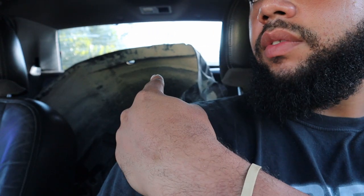because I searched it before we started this. We actually had to cut the full exhaust out and basically weld a pipe that bends back underneath the car and comes back to the front of the car on the right side, and take out the right side wheel well. That's actually what you see in the back there right now. Just so we have space to put that big turbocharger.